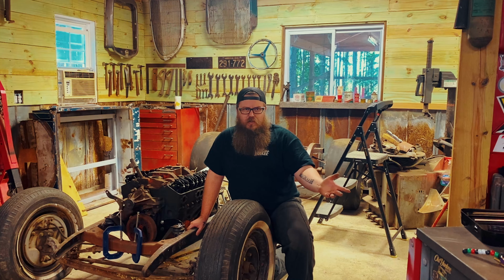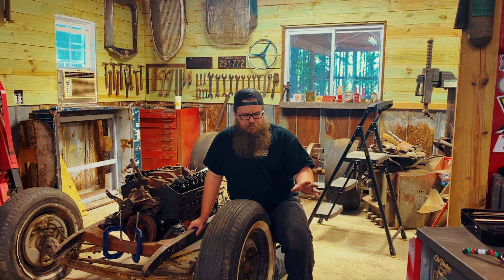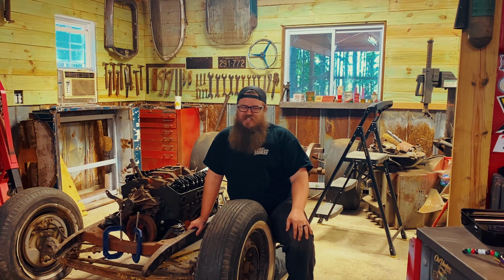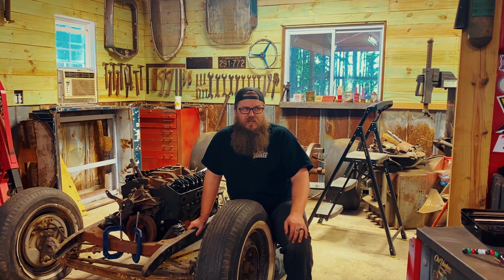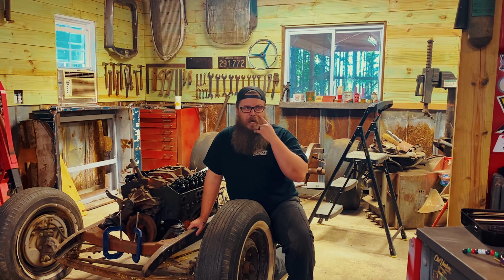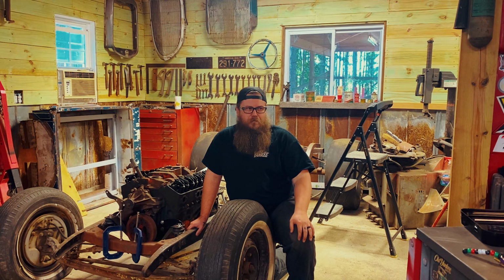It doesn't need to be solid welded, honestly. You can stitch weld it, seam seal it, call it a day. I want to solid weld it just because I can, and that's the only excuse I have. Just, hey, it's upside down. It's easy to get to right now. When I throw it back on the frame, it's never going to be easy to get to ever again because this transmission and everything is really, really tight in this car since it's channeled so hard.